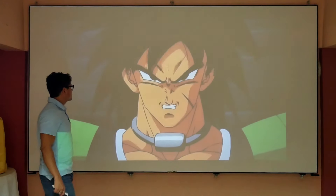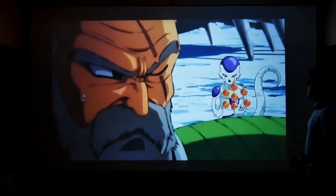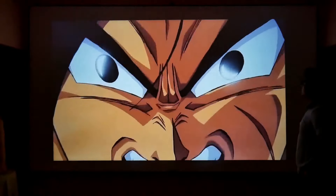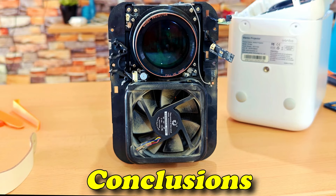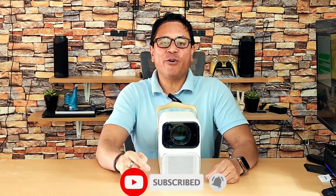This Whambo 6 Max is now well repaired. I charged for my work, but I was very detailed in doing it, so if you have a similar problem, maybe we can talk about it — only if I have time and the issue is known, as very complex problems might not have a solution. I also learned a lot and I'm happy to see this projector has regained its former glory. I didn't just change the polarizing filter — I also did maintenance and even cleaned the lens from the inside, so it has a few more years of use. As my grandfather used to say, everything has a solution in life, and in the hands of an electronic engineer even more so — so subscribe to my channel, because I create valuable content here. Let's democratize technology.